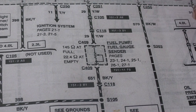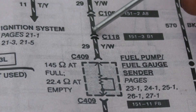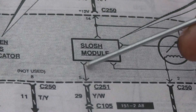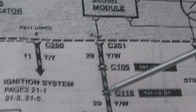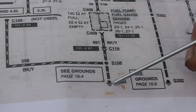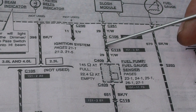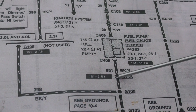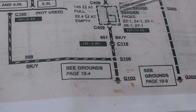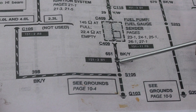If you remember when we did our test under the hood, I was connected up here on this female connector for my pot — one side connected on the female side of C118, which goes straight into the slosh module. The other side I connected directly to ground. After we got the bed off, I came back and did one more test — hooked it up again at the female side of C118. I wanted to verify that the ground connection going through the splice to G103 was going to be okay, so I took my black lead on my pot and connected it on the female side. Everything worked fine.